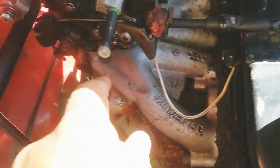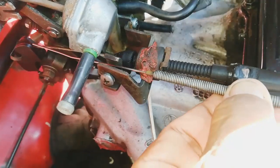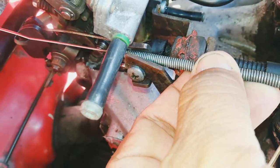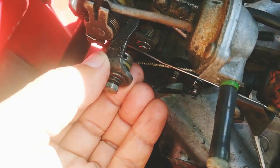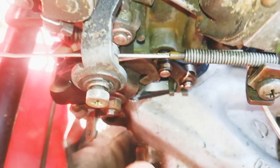Your cable is going to go inside these two nuts here — this one and that one — that's how the cable is held fast. So the first thing you do is take your cable and put it in this groove here, but don't tighten it yet. Next, pull this arm here — this is the arm that controls the flap in the carburetor — pull it towards you so that you can see the hole there. That hole is where we insert the cable through. Now you can see the cable is through the first screw and also through this arm which controls the flap in the carburetor.